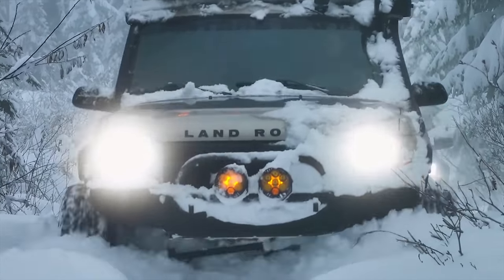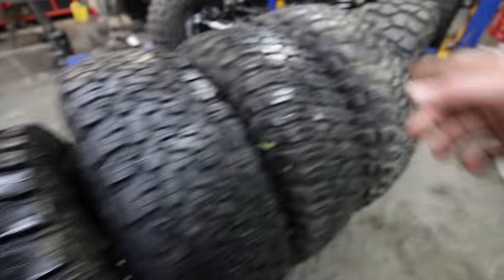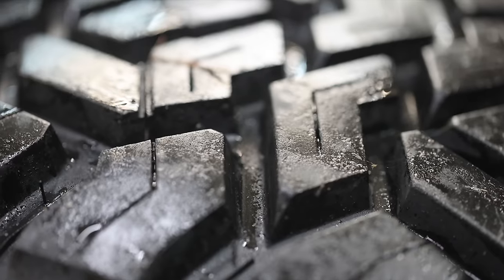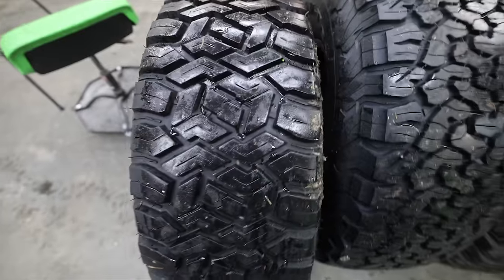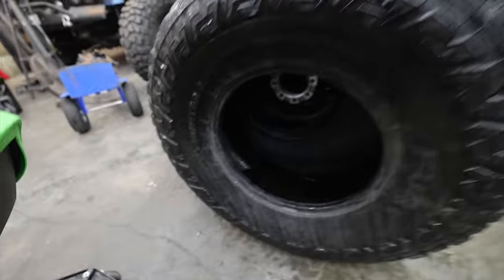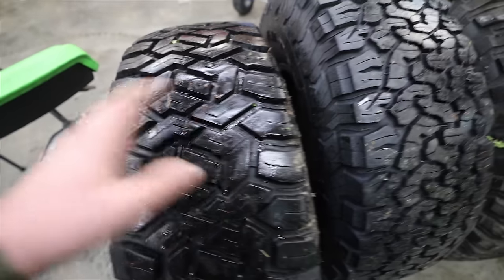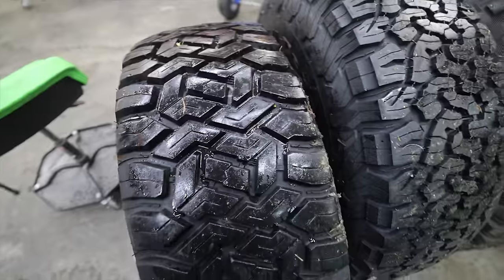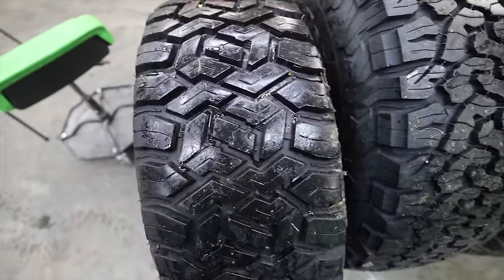This is this new generation of hybrid tire. As you can see, the tread is a little bit closer together than you'd find in a more aggressive mud terrain, which is why they call this an RT. But in between the tread, everything is tapered, just like you'd see in one of these other mud terrains. I have used these — these are Fury Country Hunters, pretty cheap tires. I used them in the snow and they were pretty awful. Even though it's wide and it did air down okay, it just couldn't hold onto any snow. It really wanted to dig in pretty much any environment.